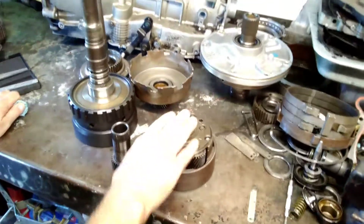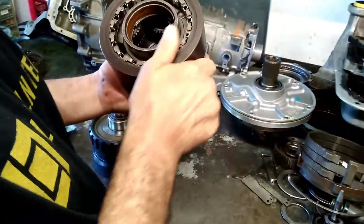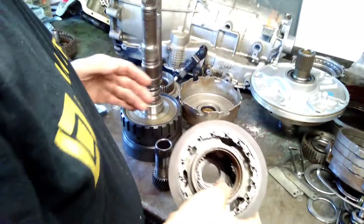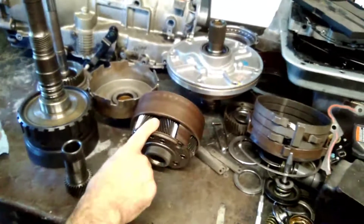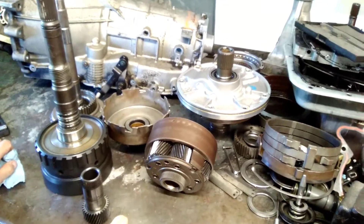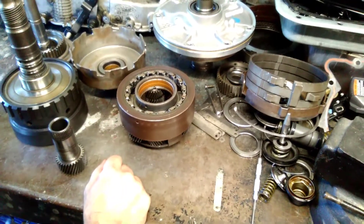The ring gear has no washers but there are bearings. There's one bearing you almost have to second-guess — it's a trap down inside and you have to make a judgment call. If that bearing gives up, that's where the damage comes from: the little bearings come out and wipe out all the teeth, taking out basically all four components of the planetary set. At the top of your task sheet it'll ask whether this is a Simpson or Ravigneaux set — this is the Ravigneaux, spelled R-A-V-I-G-N-E-A-U-X. Follow those procedures and that should get you all the information you need on these two task sheets.